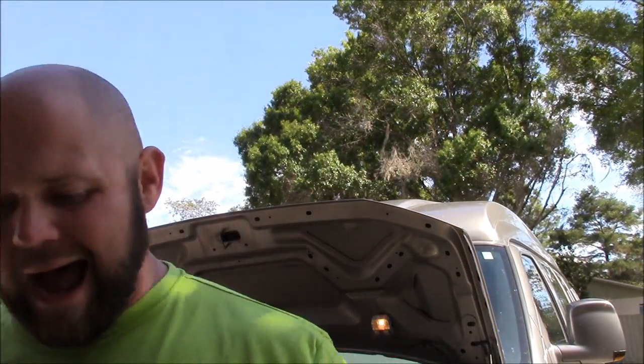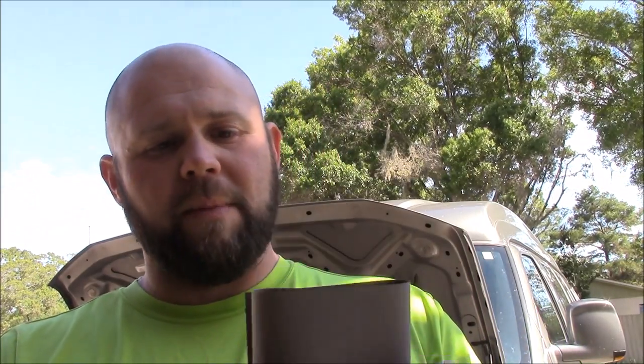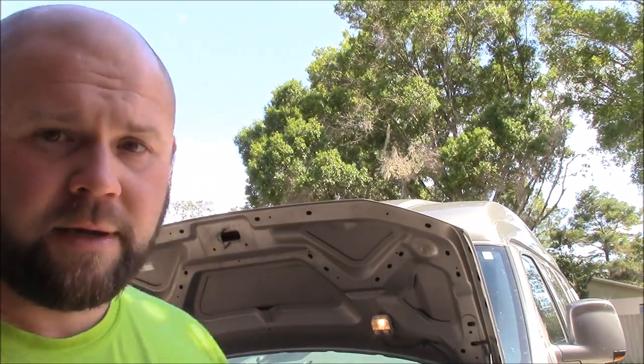I'm going to pull out one of these sheets and fold it in thirds. I do not like using a lubricant in my water for sanding. I don't use Detail Juice in my water for lube — I use straight up water. You want that sandpaper to bite on the surface; you don't want a lubricant to prevent the abrasive in the paper from doing its job. So I use just straight up water.